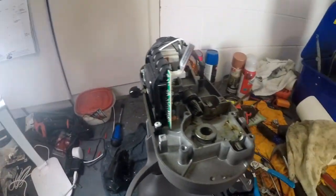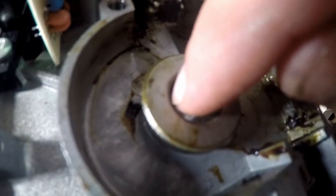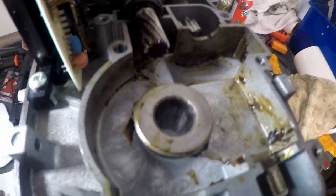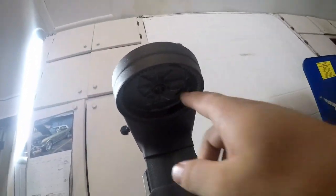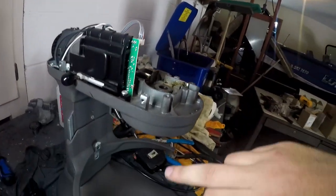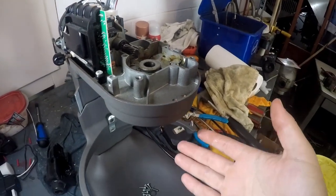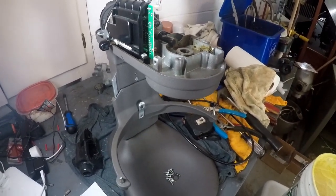Now that we got everything cleaned up, we're ready to start putting it back together. Before we start putting any grease in, I want to take note. This is called the planetary bearing sleeve — it slits down in there, slides right in. Take a look at the inside of this wall — if you see any major scarring, big gouges, or anything like that, we probably want to replace that. Also if it's super loose, might want to replace that as well. Another issue I've seen with these machines is it actually starts to crack around this casing up here, and this whole piece comes loose. If that is the case, we will have to actually replace this entire lower housing, taking the motor, speed control, and everything out and putting a new one in there. It's about a $50 part.